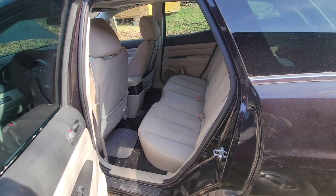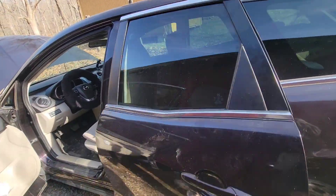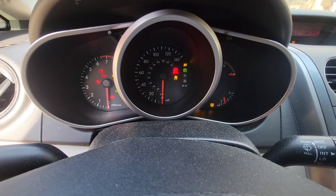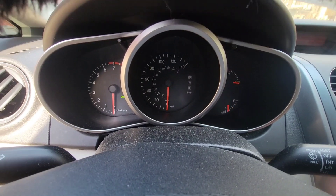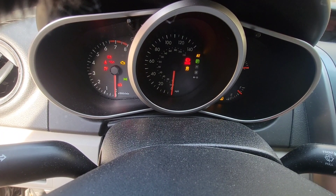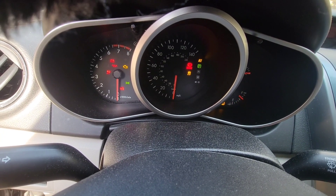There's your seat reinstalled — very easy, just pull up on the front, push the back end, and lock it into place. Now we'll come here and cycle it a couple times so the fuel pump can build pressure, since the system was completely drained. At least three or four times.